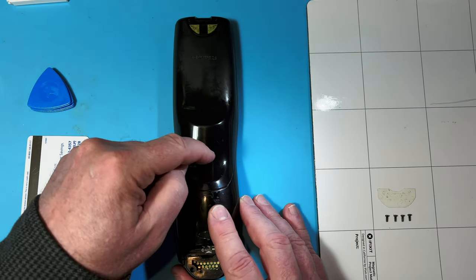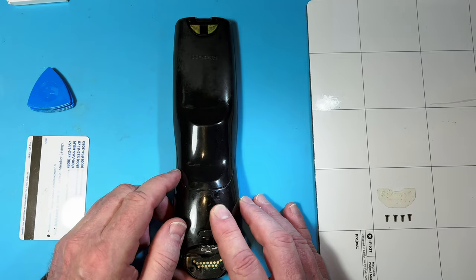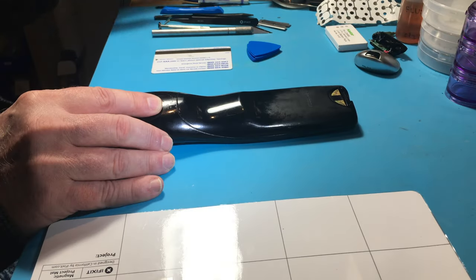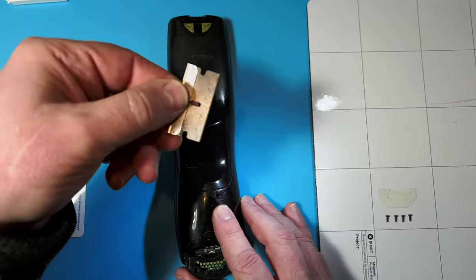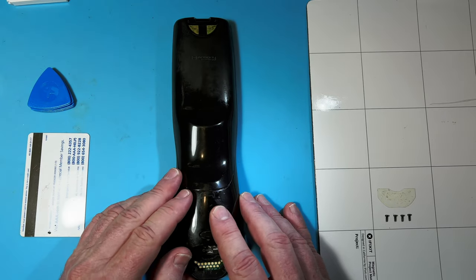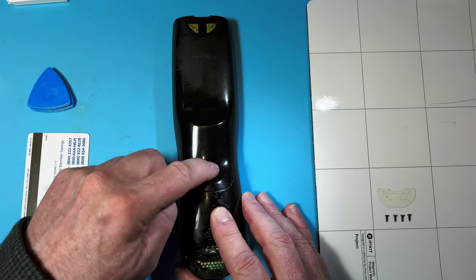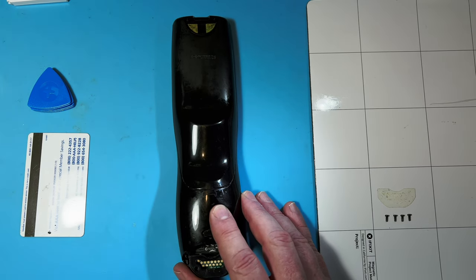But anyway, there's a piece of glue tape underneath this supposedly, and then clips down each side. And so I'm going to heat this and try to go in the bottom and see how well we do. I've got all my iFixit picks and cards and screws and all this plastic stuff. Generally, I find metal tools work better, like a nice single-sided razor blade, even though you have the potential to damage the plastic. But this is always so crazy because you're always afraid you're going to break off clips, but there are screws under this we need to get to separate the two halves, so that's the problem. So first, I'm going to try heating this up to loosen the glue tape, and I don't know exactly where it is. I don't know if it's here or here, but, yeah, we'll see what happens.